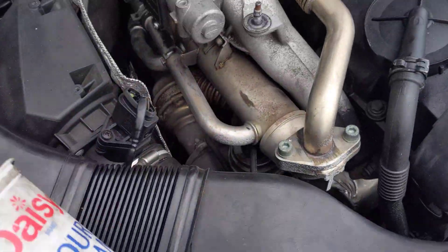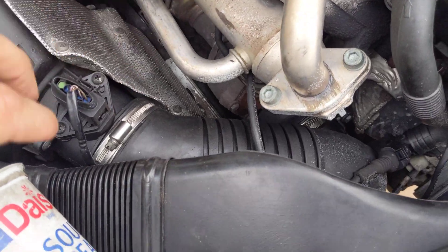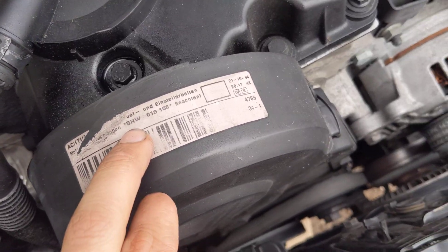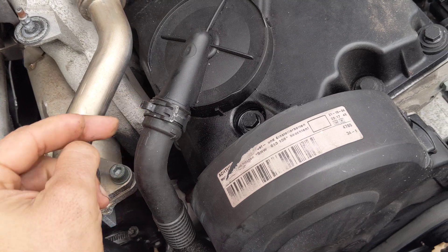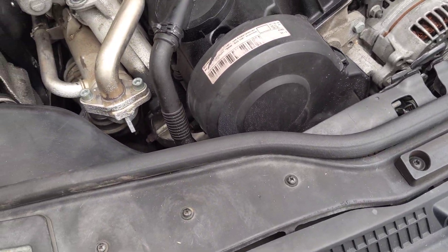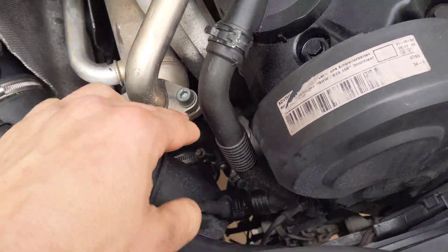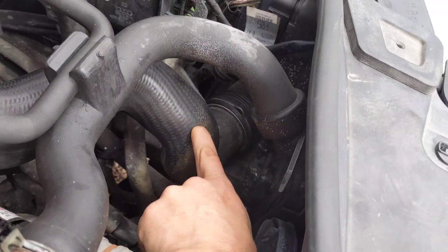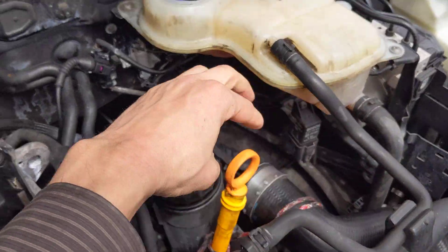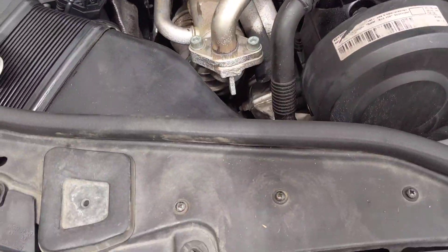Get a three-quarter inch rubber cork from Home Depot or Lowe's and that should work fine. You're going to stick the container in the beginning of your intake hose - remove the clamp, put it in there, and pressurize your intake. Disconnect any hoses that go to your intake manifold so you're just testing the intake system. This is on the BHW engine. When you pressurize it, it pressurizes before the turbo and after the turbo, which runs along the bottom, then up through the intercooler line over to the throttle body.